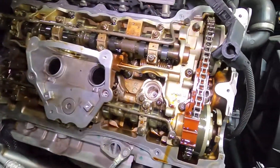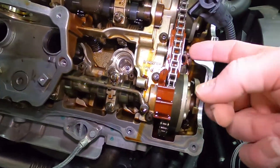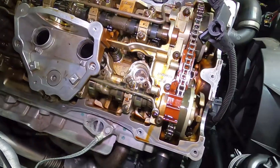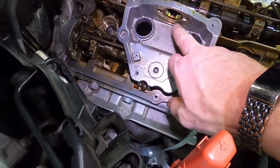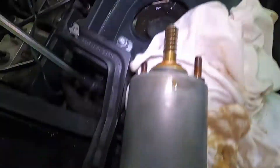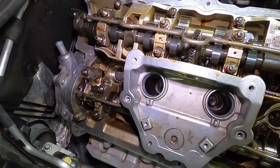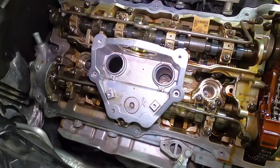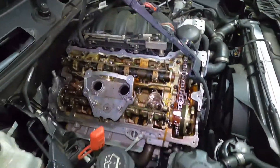We're at the midpoint. The sensor is off - it was really tricky with three little bolts, one of which you have to put the socket straight through the guide on the cam chain. The motor is also off. The seal was leaking a little bit, and we have a new seal with the new motor, but I want to put a little bit of silicone on there as well to make sure it stays tight. Then we get those two back on and start reassembling.